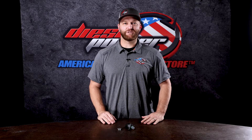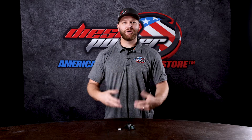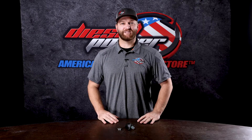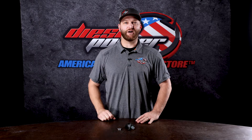This is honestly one of those commonly misdiagnosed items. This is the pro-tip backyard version to see if your FCA is possibly causing any issues. If your FCA is clogged or it's stuck, and it's not allowing the pump to basically build pressure and send it to the rail, one of the ways you can test that is turn the truck off and unplug the FCA, and try and start the truck up.